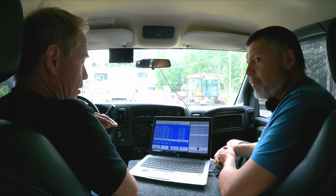Next we check fuel pressure to see the health of your injection pump. This is the heart of the engine - it makes all the fuel pressure, makes all the power, drives your turbo. Everything starts with a healthy fuel pump. We can command it to full rail pressure, which in PSI is about 26,000 pounds per square inch, and around 4,000 at idle. The scanner reads in megapascals: 30 MPa is around 4,000 PSI and 180 MPa is your 26,000 PSI. The actual sensor value is perfectly following the commanded value - if you had a weak pump you'd see a separation between those two. This fuel system is very healthy.